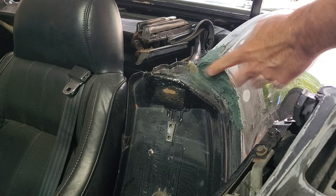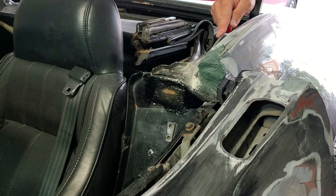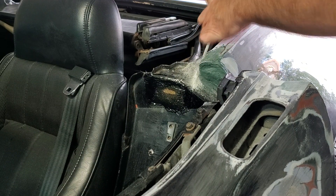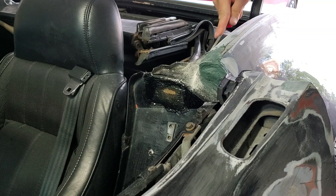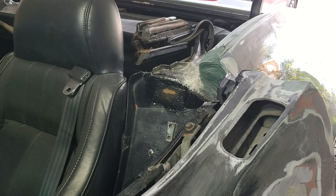You can already tell this is starting to harden up. Give it another 10 more minutes and then I can come back and start sanding it. So I'll get this little groove here — I'm using a file. The sandpaper is just too hard to get in there. We just want to make that little groove, and this is from that fiberglass that I did. A lot faster, then we'll come in with the sandpaper.